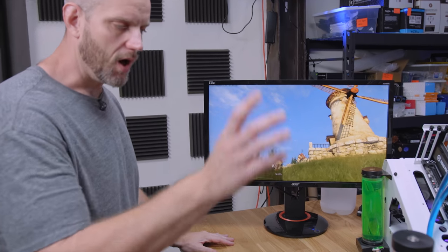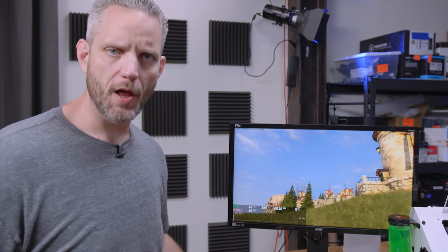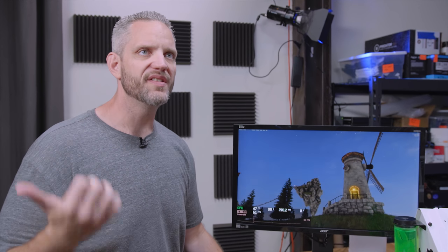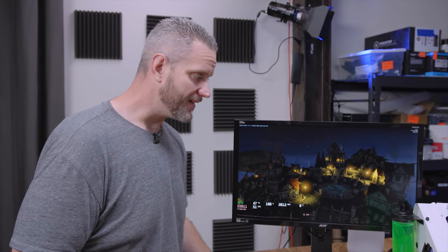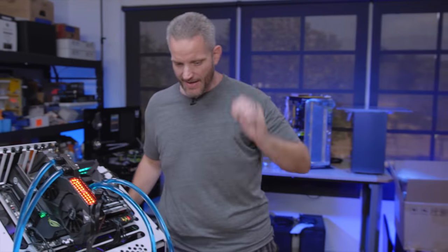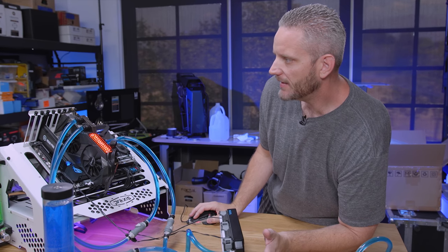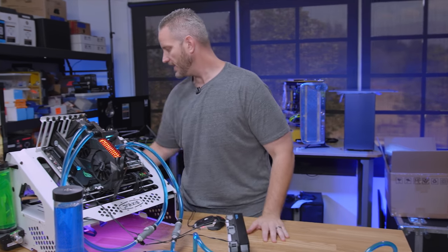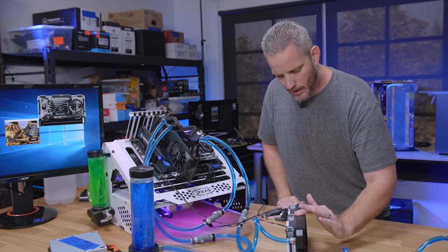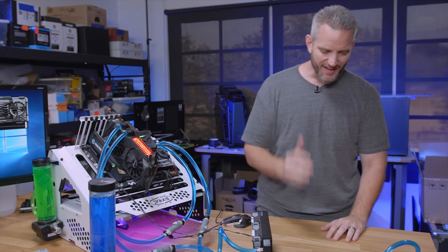47°C is where we capped out on the dual-pass radiator — that's your pretty standard rad. Our CPU was at high 60s to low 70s. So now we're going to run the exact same test on the cross-flow. I'm going to let the coolant come back down, turn this off, let it cool. My prediction: I really do not think anything is going to change. I think we're going to get the exact same results — I kind of hope I'm wrong, but that's my prediction.